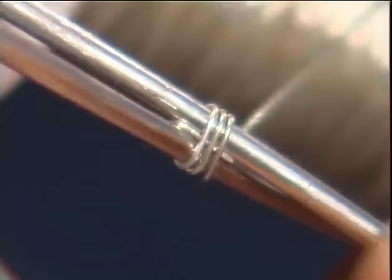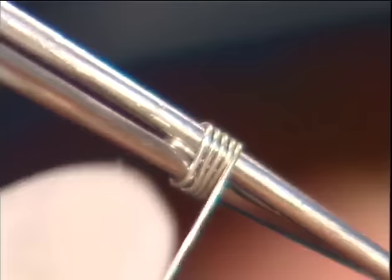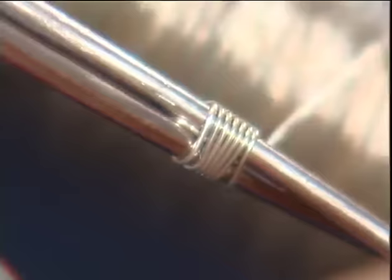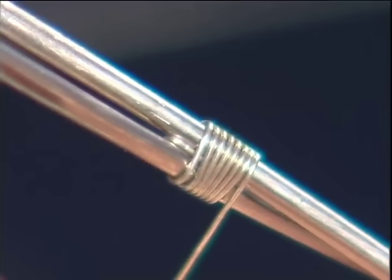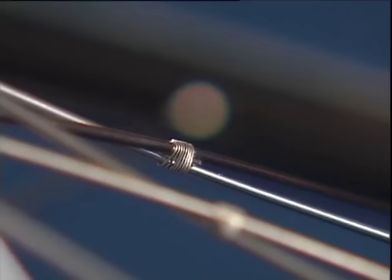A tied and soldered wheel tends to be stiffer and reacts more directly to out-of-saddle riding, as well as accelerating more quickly. A benefit with disc brakes is a shorter and more controllable delay when braking. We also attain an advantage on the front wheel. The wheel can be steered more directly and therefore more exactly.